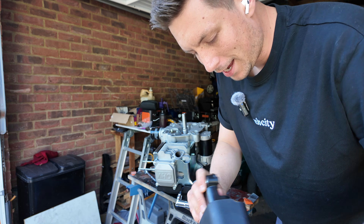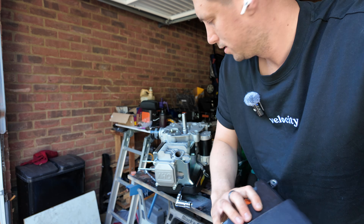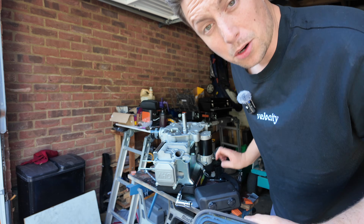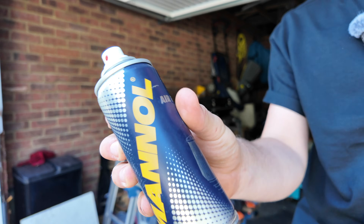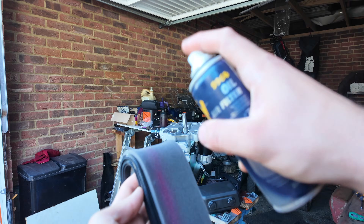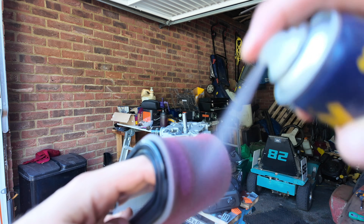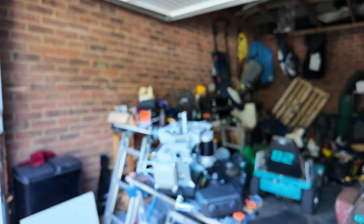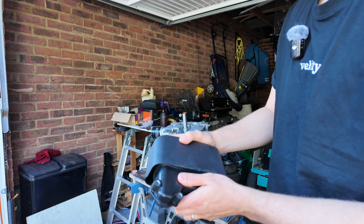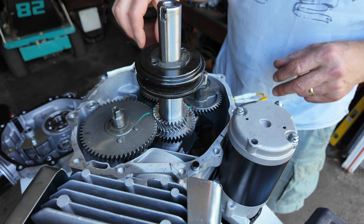It's another day but I'm back out here working on the engine. Next thing is the air filter - it's very dusty when we race, so I'm going to put some filter oil on it to make sure fine dust doesn't end up in the engine. A while back I had super fine dust get past the air filter and into the oil, which killed an engine. For a 12-hour race, if you have an engine blow-out that's the end of your race, so you've got to be super careful.